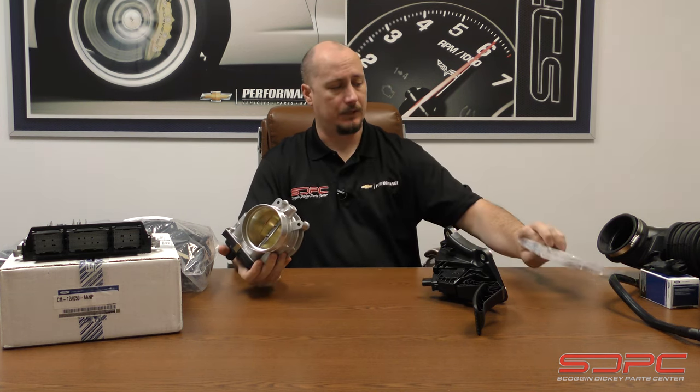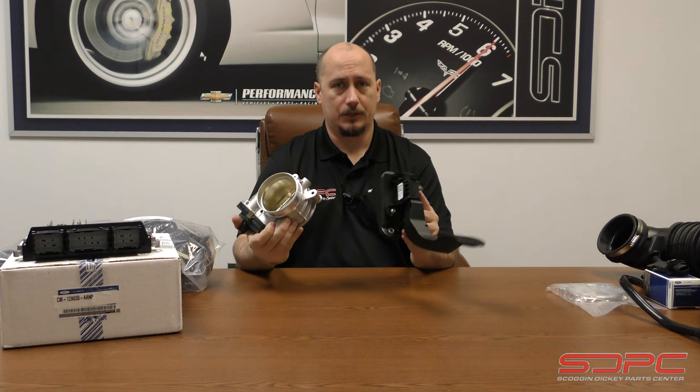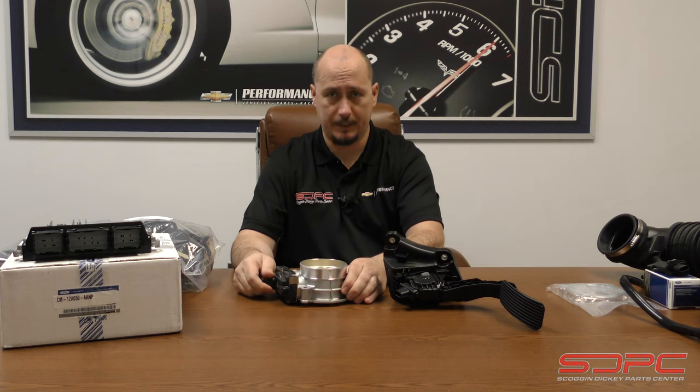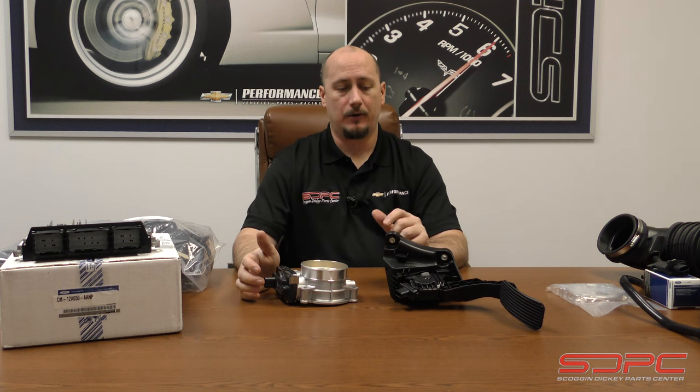It's really nice because this comes with a drive-by-wire throttle pedal. This whole assembly is something that's really important to be mindful of, especially when doing a swap — you don't want to mix and match a throttle body with a pedal that are not initially compatible. You might think, oh, this is from the same year model but a different vehicle, that one should work. Sometimes it just doesn't work out that way.